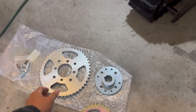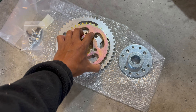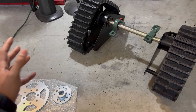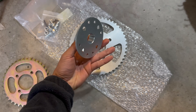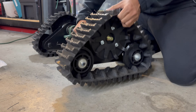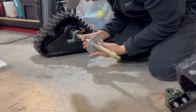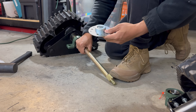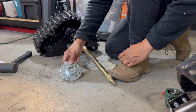I'm going to take apart the track assembly again so we can fit the new sprocket in place. This is a 420 48-tooth rear sprocket, which is a lot bigger than the one that came with the kit because I'm looking for as much torque as possible. This is a snow cart, so I'm not really targeting super high speeds — I just want to make sure it has climbing power if we need it. This is just a generic go-kart rear sprocket kit and adapter meant for a one-inch axle. The inner bore on the sprocket adapter is definitely too tight — I might have to go with a different one or get this one modified.